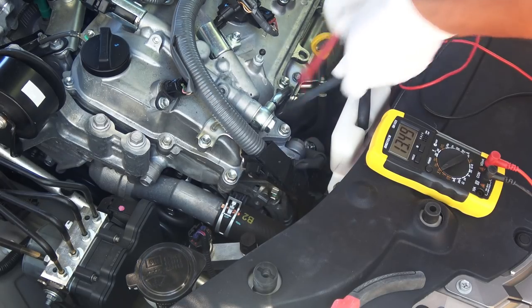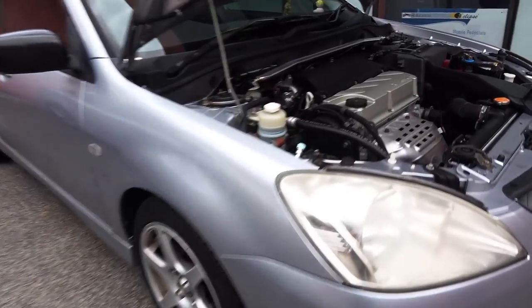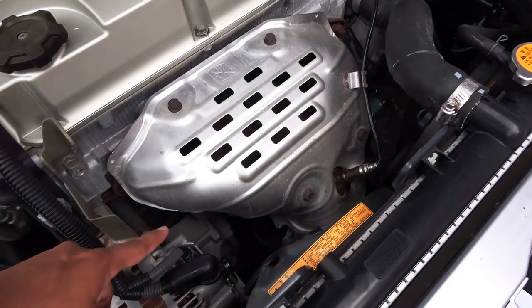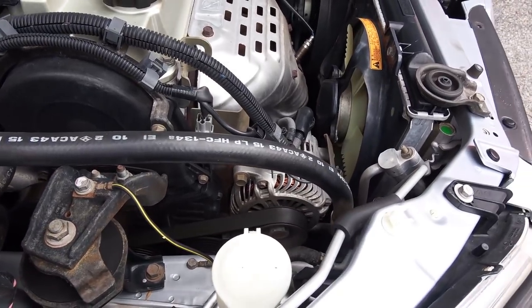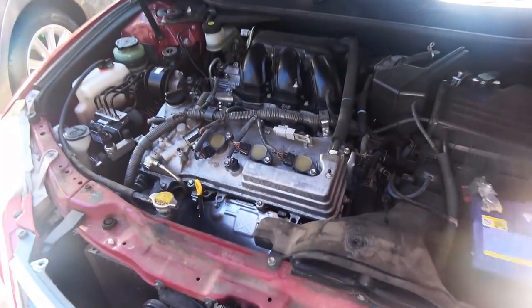That's how to properly diagnose a bad alternator. On some cars like a 2004 Mitsubishi Lancer, the alternator is really easy to access — just undo the two bolts holding it, unplug the electrical connections, loosen the tensioner pulley, slip the belt off, and remove the alternator. But in my car it's much more involved.